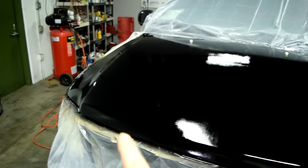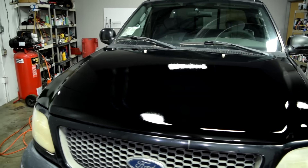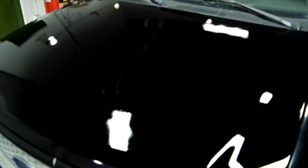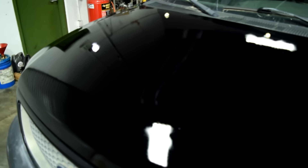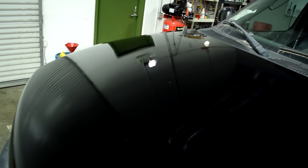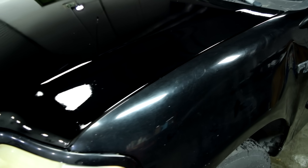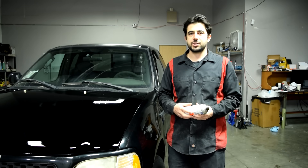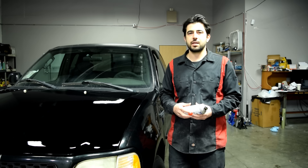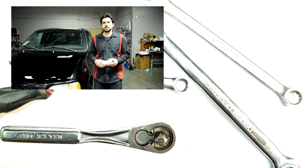An hour later, here's the final look. We got good coverage with the base coat and were able to blend it pretty well — you can't tell where the primer and repair area was. It is going to need some wet sanding and polishing, as expected. You'll also need to polish the adjacent panels so the newly painted panel doesn't stand out. If you enjoyed this video, share it on your favorite social network and check out the other related videos linked on screen and in the description box. Thanks for watching!